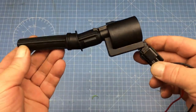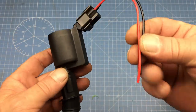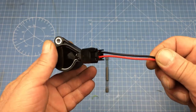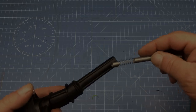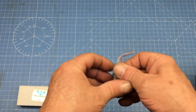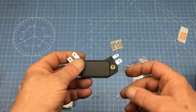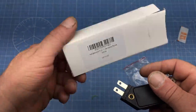For the ignition system, we're going to go with a coil-on-plug system. This coil is from a Ford product, and it's not known for its longevity, but they are common and you can get them at any store. Being that it only has two wires means it's going to require an igniter, because the Speeduino cannot directly trigger this due to the power demands. This is an igniter, sometimes known as an ignition control module — it was made for an older General Motors high-energy ignition system, so it should be able to handle the demands of our Ford coil.